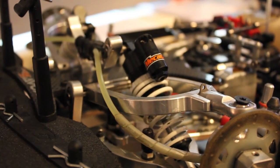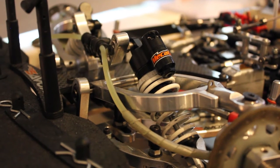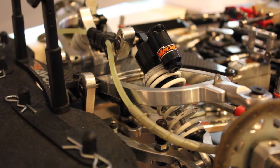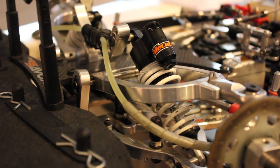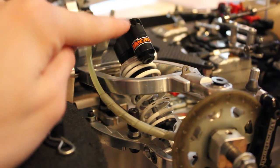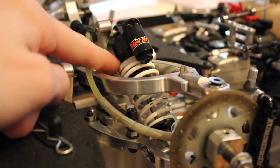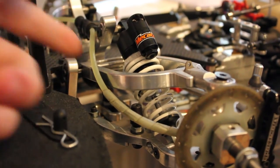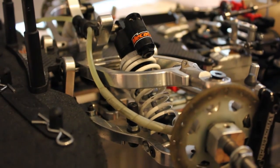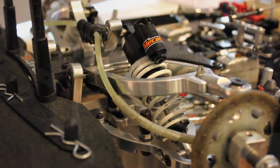To keep all this weight and power planted and fast through corners we need advanced shocks like these — the newest shocks from Mechatech. They are very versatile: you can tune the hardness of the spring, the oil inside, and screw them to change the ride height and preload. There's a little chamber on the top so that when you crash and the oil overflows it has extra space, keeping your shocks safe in any situation during the race. You can control the preload with a little screw through these bolts — simple but very efficient, basically like on a real car.